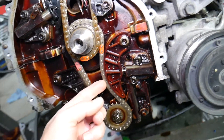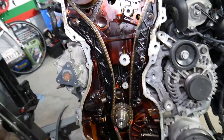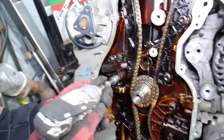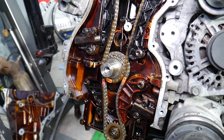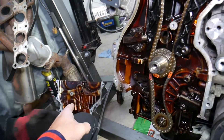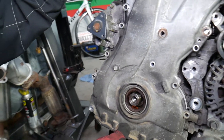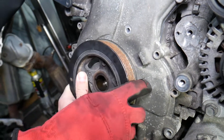We'll demonstrate how to remove everything from start to finish, including the oil pump itself. Next we'll verify TDC — top dead center. You can put the timing cover on temporarily to verify, or check the T-mark on the crankshaft pulley. Another method is to remove the spark plugs and bring all pistons to the middle position so you can't easily bend any valves.